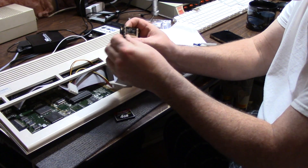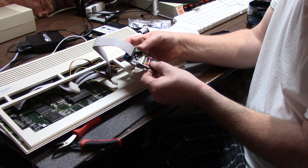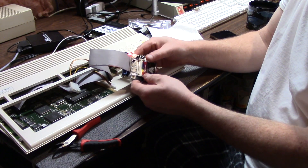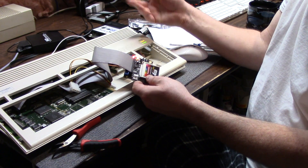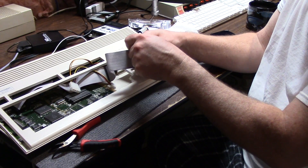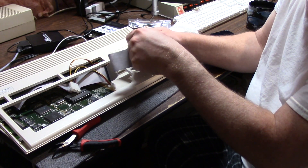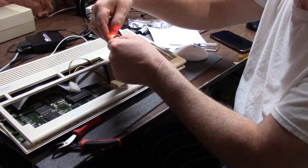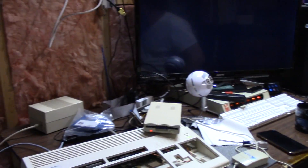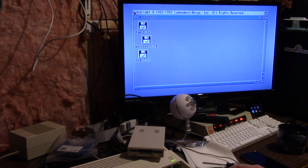We're going to move JP1 to 44-pin IDE. What's weird is I was still getting power that way. Let's try it again. Power is in the card. Floppy tries to access but it can't. Then this should start going — LED1, master is present. The old red light is working. Workbench 3.0. DF0 is not connected. 2 megs of chip.